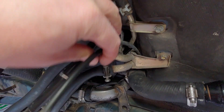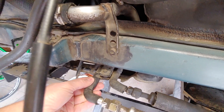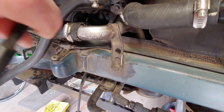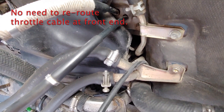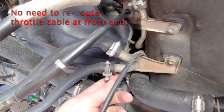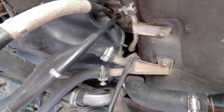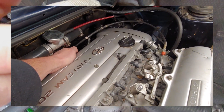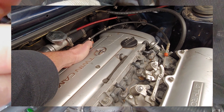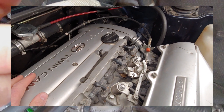The throttle cable is already rerouted in my car. It normally comes out down low near the AC lines, but you need a little more length — a little more slack on your throttle cable — to make it reach the throttle bracket on the 20-valve engine. The very easy and common solution is to just remove a couple of brackets and reroute the throttle cable up through a higher location to give you a few more inches. I've zip-tied mine to one of the hoist hooks, and I've got plenty of slack — it's mostly out of the way and looks pretty good.